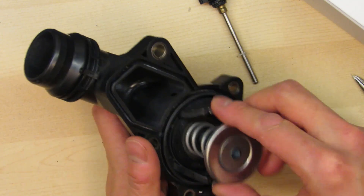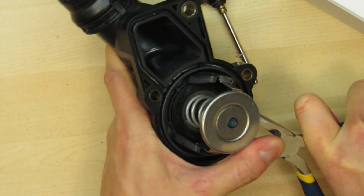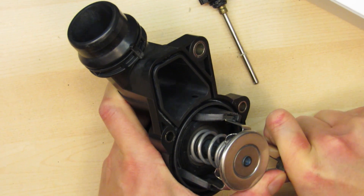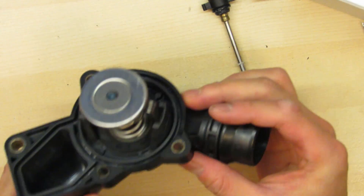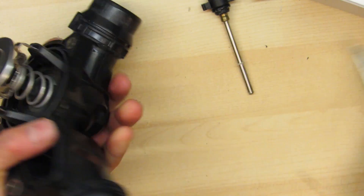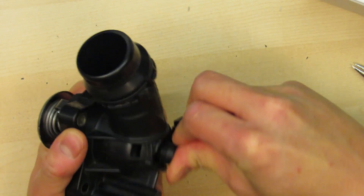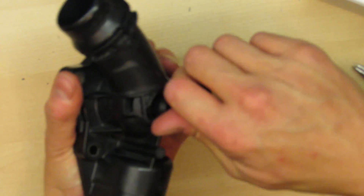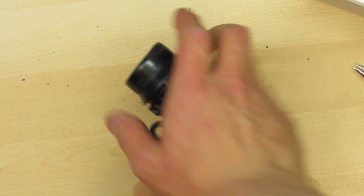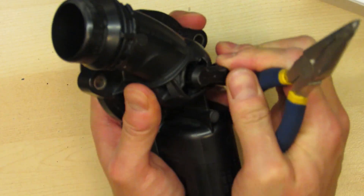To reassemble it, just put this back on. You can use needle-nose pliers, put it on the floor on a rug or something, and push down on it — that will pop the clips back in. Once it's back in, make sure the clips are fully engaged outward. Then this piece — the shaft and heater — just pushes in the back, and once you get it in enough you can turn it to lock it into place. It takes quite a bit of force; you can hammer it in and then turn it into place.